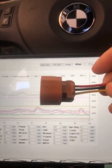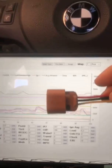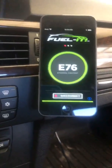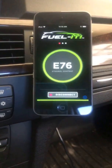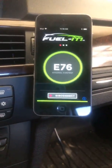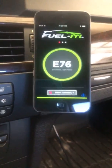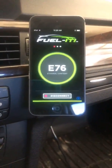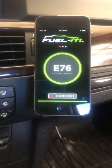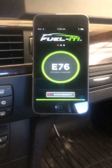Just to reiterate: all of our sensors — Bluetooth or zero-to-five volt — have Bluetooth output. Every one of them can be used with our app on an Apple or Android device. The only choice you have to make is zero-to-five volt or raw signal, depending on which tune you're using or whether you're using a JB4. If you're not using either of those, it doesn't matter — you can order either one, you'll have the Bluetooth signal, and you can monitor your ethanol content on your Apple or Android device. I hope that clears things up and makes it easier to understand which analyzer you need. Thanks for watching and we'll catch you next time.